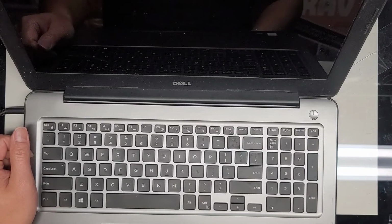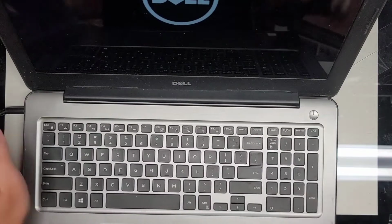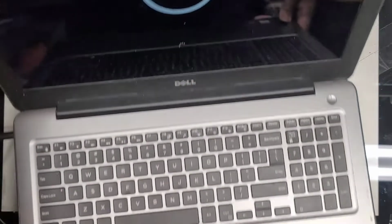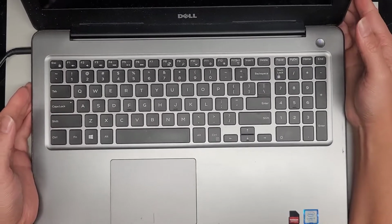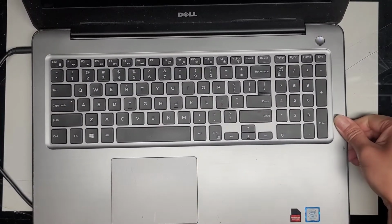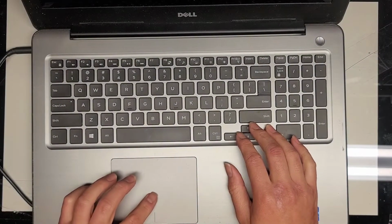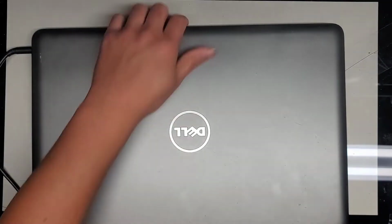Sometimes it can also be the RAM, so let's see. The CD drive's like beeping a few times. Yep, okay, so I think the battery was just low, and there you go, it's powering up. Okay, so it's not complaining about anything now, so I think that should be good to go. We're gonna make sure to pop all of this back in all the way. Okay, make sure all the clips are in. All right, and the battery's super low, so I'm gonna just shut it down now. We'll let it charge a bit. We'll get all the screws back in, and that's all there is to it.